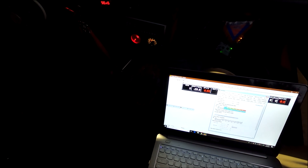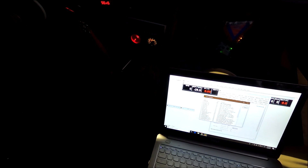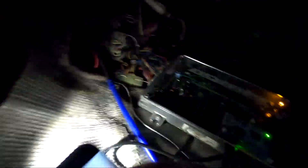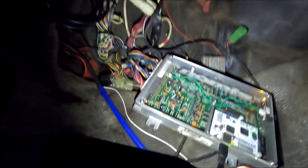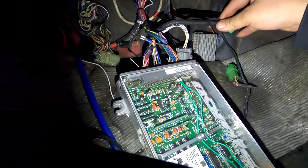I'm going to save this map — I have it on this laptop already but I like to save it and date it to make sure I have the latest version. I'm going to go to new calibration and I'm looking for a bone stock GSR map because this is a complete GSR motor. Right here we've got stock P72 GSR 94-95 OBD1 — I'll select that map, disable a few things like the O2 sensor, just the stuff we're not using, and upload it to the ECU. I also completely forgot — we're running OBD0 injectors this time around. My last set didn't need the resistor box so it was blocked off. All I've got to do is take off the plug and my resistor box is already sitting down here — just plug that in.